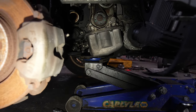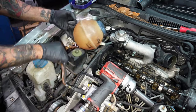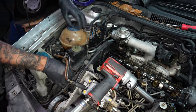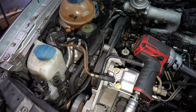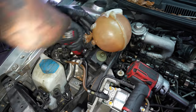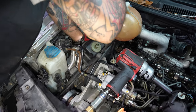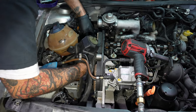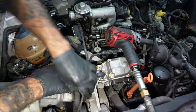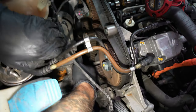We're going to jack the motor and take the bracket out of the engine — be careful with the oil pan, 18mm. Now we've got a couple of 16s that have to come out for the lower bracket, three 16s total. Rookie move is breaking this — and someone who's already been in here has broken it. That's a bummer, but whatever.